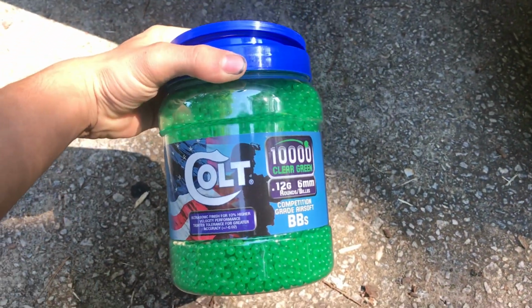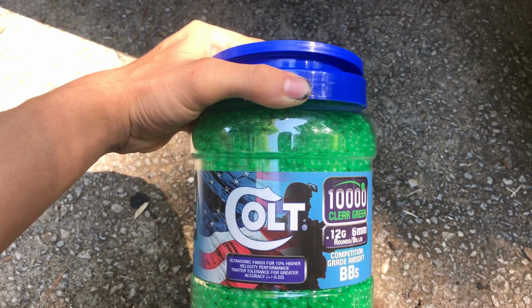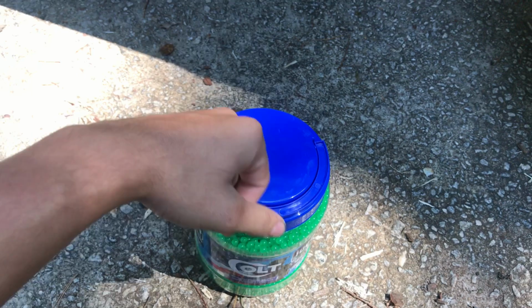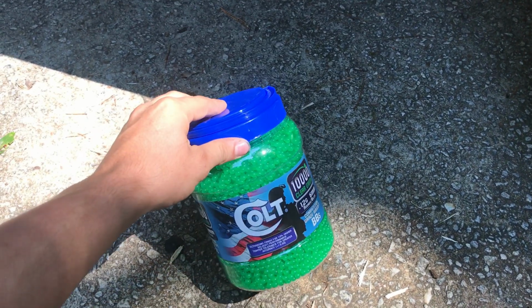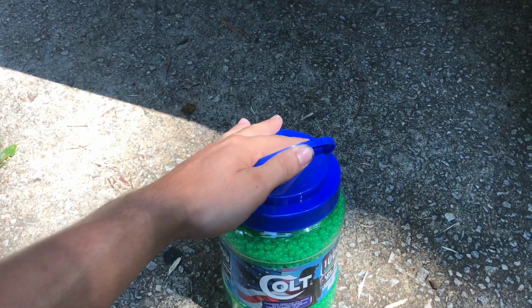I've seen a lot of guys do the airsoft BB trick. So they divide it into 4 cups. They recommend about 6 ounces in each wheel. So I'm gonna go ahead and do that. And it should self-balance due to the centripetal force of the tire itself.